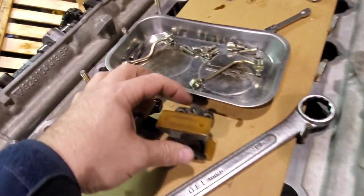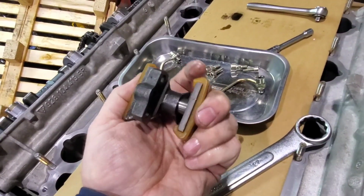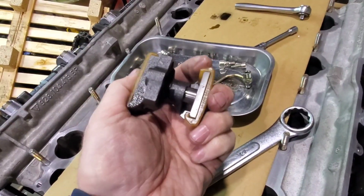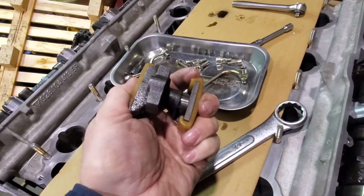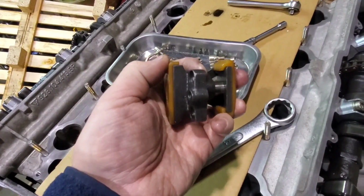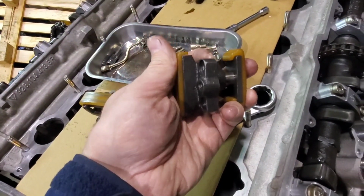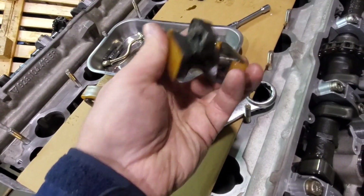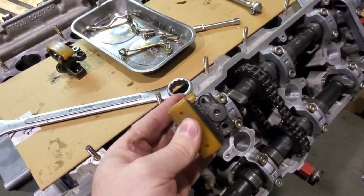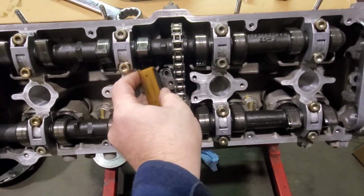So when you look at the two tensioners, you can see how they are mounted, and you will see one of them is the tensioning side and one of them is the hard side. Obviously the tensioning side needs to go to the slack side of the chain, or the side that is not pulled. This then also has the nylon pad being dragged upon, with this little lip at the leading edge so that it can't just rip the chain pad right off. It is imperative that that gets put into place correctly and that you do not reverse them head to head.